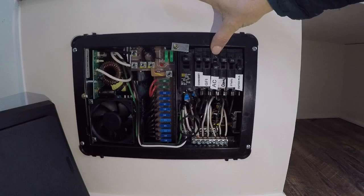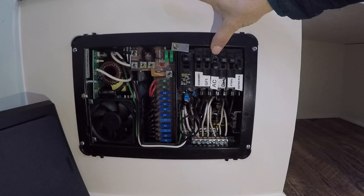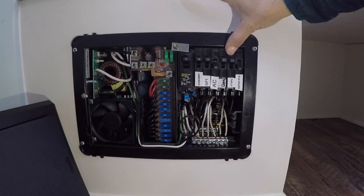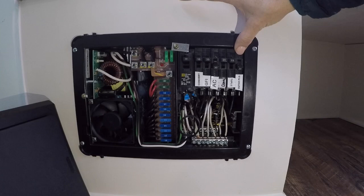That gave me a little bit higher amperage if I needed it for anything else. My 30-amp breaker for my air conditioner, which I don't have on right now — it needs a little work, so I've waited, but it's all wired up. I've got another 20-amp going to one side of the kitchen area that has two plugs and then one that will run the convection oven — a little toaster oven thing that I'm going to install instead of a regular stove. The 15-amp is for the plugs on the other side of the RV — TV, general plugs. And then there's a 20-amp running to one plug inside, but it also goes to two plugs inside the outside access hatches so that I can run power tools or anything I want outside when I'm cooking and chilling out.